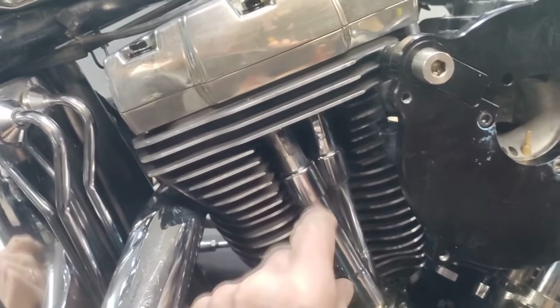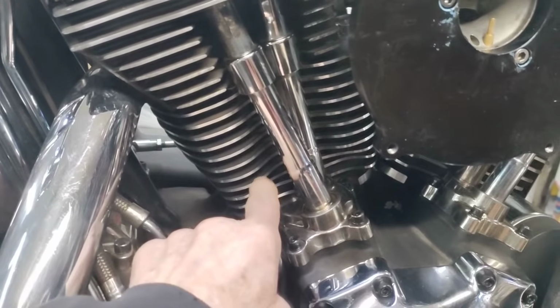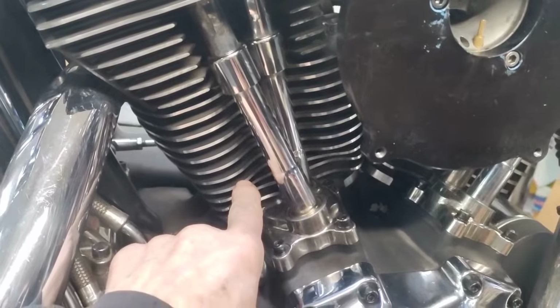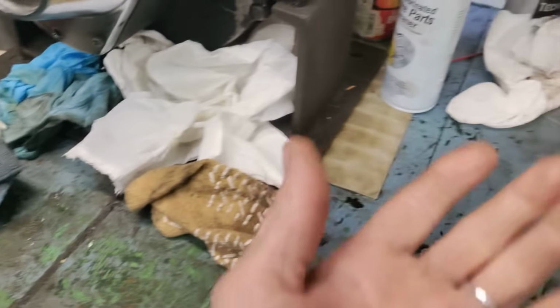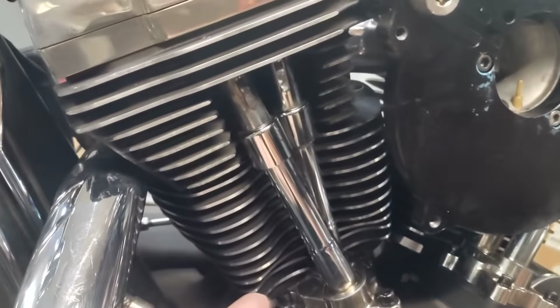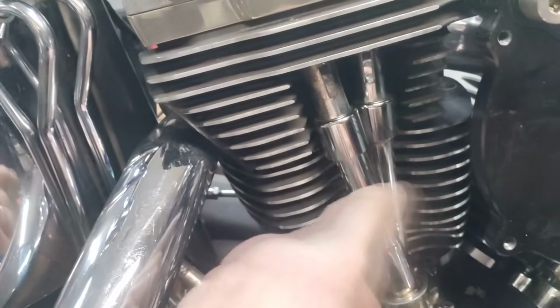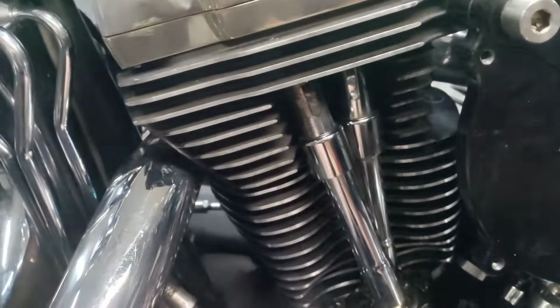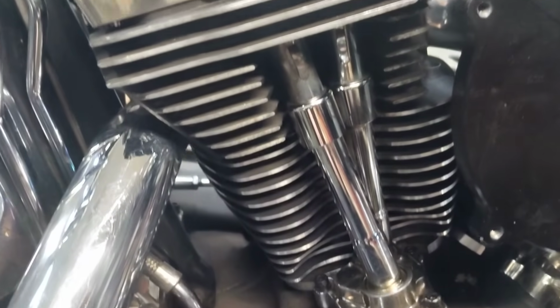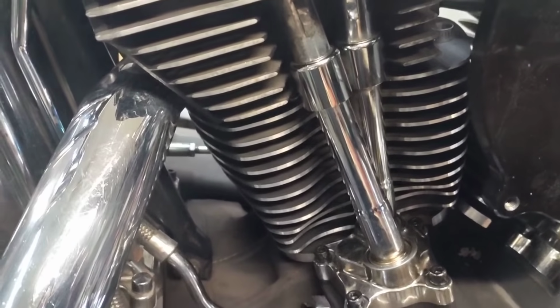I thought I would try something, maybe I'm wrong, I was just thinking ahead. I think it worked, putting the piston in the jug on the bench, upside down, where I had room to work to get those rings down in. Then we had to push the piston up in the jug, set it, because you can't have the piston hanging out and get it past those long bolts. I think they call them torsion bolts. I'm not really sure. There's a word for it.